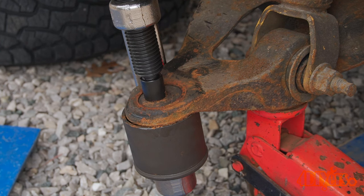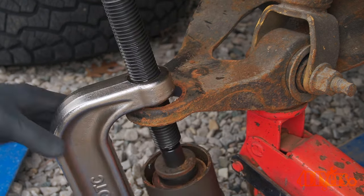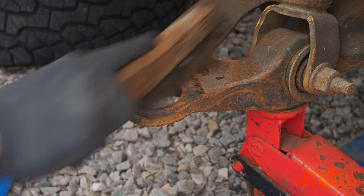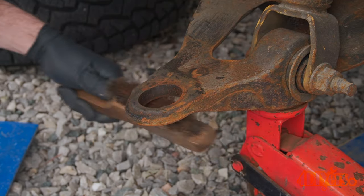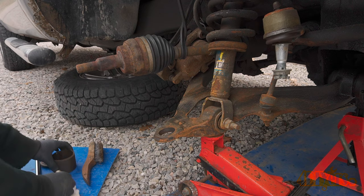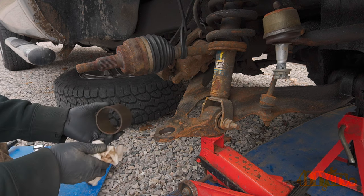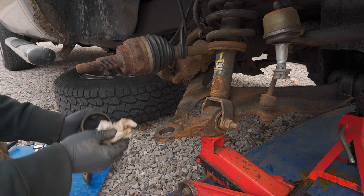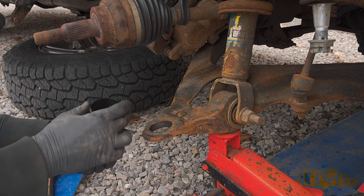The sleeve should be a larger diameter than the ball joint retaining ring. As a close up, here you can see the ball joint slowly pushing out of the control arm — eventually when it gets free, it will just pop right out. Once the ball joint has been removed, use a wire brush to clean up any rust or debris around the face and inner bore where the ball joint will be located. Do not apply any form of lubricant here. Always ensure the attachment area of your ball joint is clean. This particular ball joint doesn't have a boot installed just yet — this will be installed after, as grease and contaminants can stick to it. Compare the old and new ball joints to ensure they are the same.